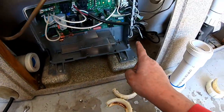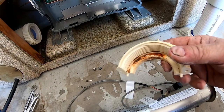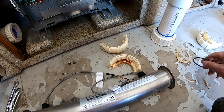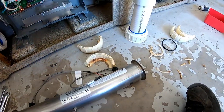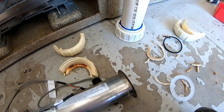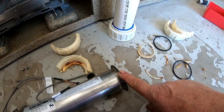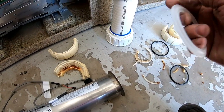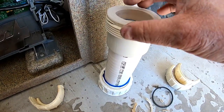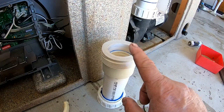The one that was leaking was this side. You can see there's a little bit of rust down there. I'll clean all that up and put a new o-ring in. This new one is more round and not flat — that'll go on top. This particular one goes for the heater gasket and it's got a little ridge that rides inside a groove all the way around, so when you push it down it sits in there really nice.